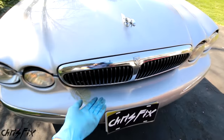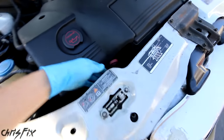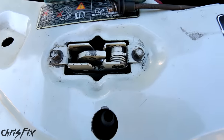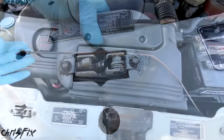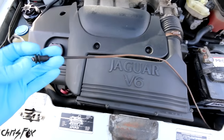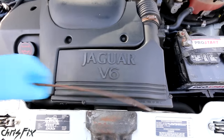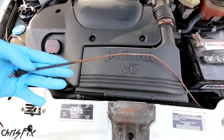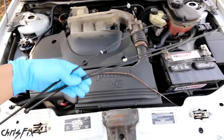Alright, that is a relief. I'm gonna pop the hood and check out the hood cable to see exactly why it's failing. So if we check out our hood release — that clicks in, we know that works — and this seems to be working fine. The reason our cable is not unlatching the hood is because it's all rusted, it's kinked, and it's just not moving at all. In order to get this to work again we're gonna replace it. It's inexpensive and not as hard as you'd think.